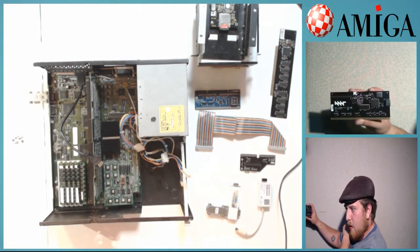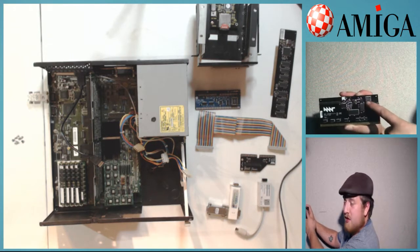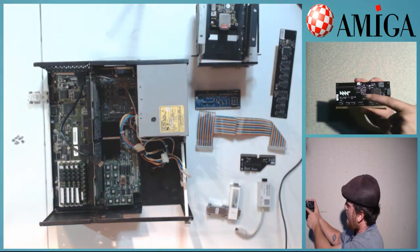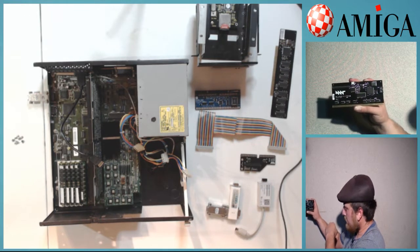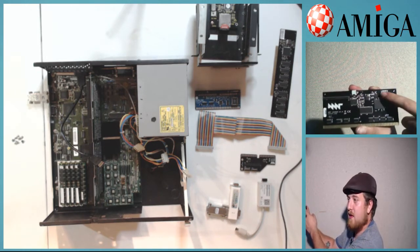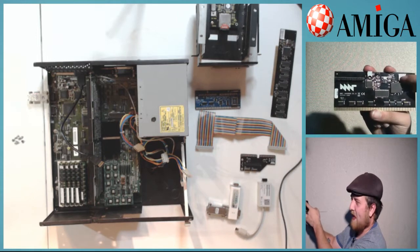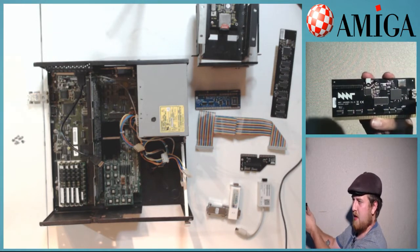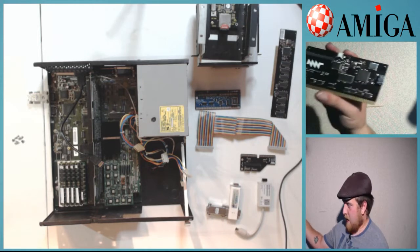There's also, for probably some of you eagle-eyed people out there, an SD storage on there. There's an additional driver that Luke offers on his webpage with the rest of his drivers for this video card to activate that SD storage. At the time that I'm recording this, I'm 90% positive that slot is still not a bootable device, but it is definitely a storable device, so it can be done as added storage. So that's kind of the graphics card as a whole.